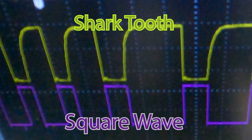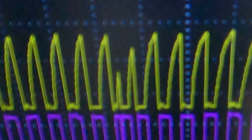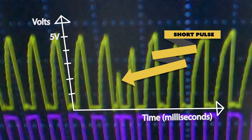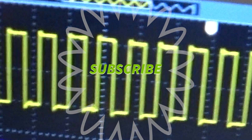Why do we care about having that perfect square wave on the crank signal? Since the oscilloscope shows what the voltage is on that wire over time, we can see that every time the voltage goes up to 5 volts — every pulse — it's taking time to get there. It builds up very slowly, and then it drops off right away. And what happens if your signal is taking time to rise? When you get up in the higher RPMs, when you have less time between pulses, that means you're not going to get your full pulse. It's not going to get to that 5 volts by the time the next pulse comes. If that voltage never reaches 5 volts, then the ECM will never know that a tooth existed there. That's exactly why we were having dropout — the pulses couldn't rise fully by the time the next pulse came in. It was losing sync, and cutting fuel, cutting spark. This pull-up resistor took care of that, and the voltage rises super sharp, super fast, and by the time the next pulse comes, the thing has already gotten to 5 volts, and it has the full signal there that the ECM gets to see, and it stays in sync.